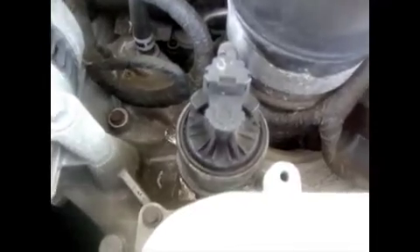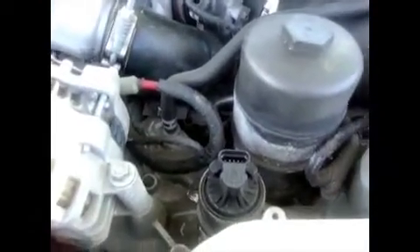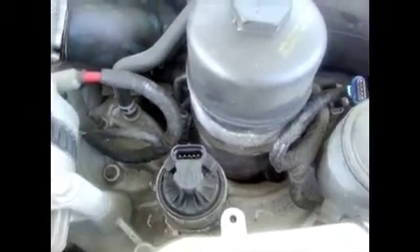There are two bolts on the left and right side — 5/16ths. I already have mine pre-loosened just for time's sake. First thing you want to do is unhook the plug, which is a little tab plug. It just pops right off. Move that over to the side. Then you loosen your two bolts, and you can get a crow's foot and pry it right out. I'll show you how to do that in a second.